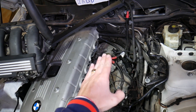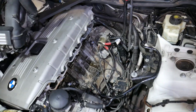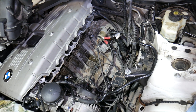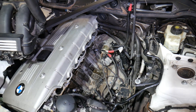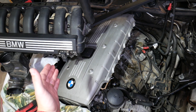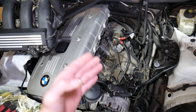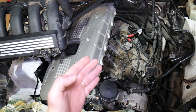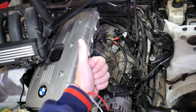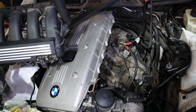When you give it gas, the RPMs will rise but slowly — not as fast as they should. You'll also use a lot more fuel than normal, the car won't be efficient, and you won't be able to pass emissions. Using so much extra fuel can even cause additional damage to oxygen sensors, catalytic converters, and burnt valves.